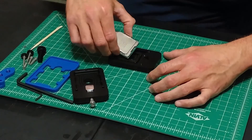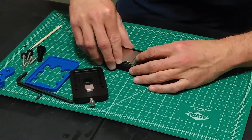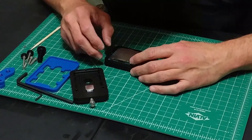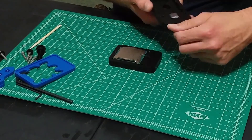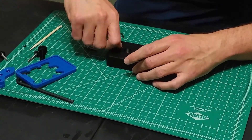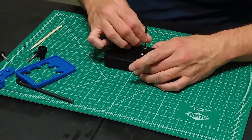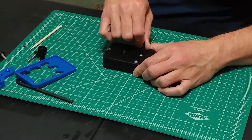Okay, so you've got everything opened and ready — it's time to put the CPU in your delidding kit. For my kit there was a triangle showing which way the CPU goes. Simply line the triangle on your CPU up with the triangle on the kit and drop the CPU in place. It should be a snug, clean fit. After the CPU is in place you need to put the top on. There are three screw holes on the top of my kit that align with three screw holes on the bottom. Get the top in place and then use the supplied screws to secure the kit. I suggest not over-tightening and stopping once you're feeling significant resistance.